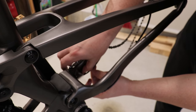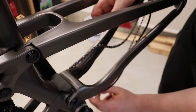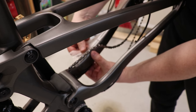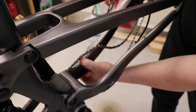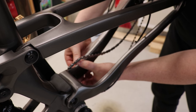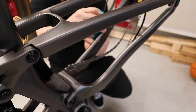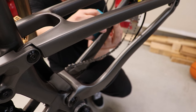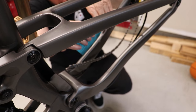I just went in there, really pushed with the thumbs and the fingers just to really get it to stick to where it needed to go. And, you know, again, you pull it taut as well, so as you're getting the air bubbles out, you're also pulling it. It's a really weird film. You can pull it, it doesn't break. It's not flimsy. As long as your hands are wet and the film's wet, you don't stick to it. So here I'm using the squeegee, and now I'm just painstakingly pushing downward. It was always downward to get those air bubbles out.